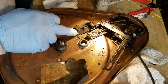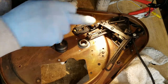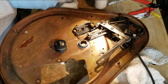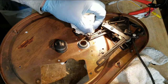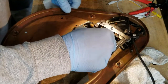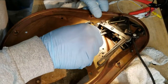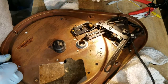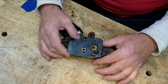There are pivot points here, here, and here — I lubricate those with a little oil. Put one drop on a screwdriver, touch the pivot point, and the oil will through capillary action go right into that spot. Then move it and dry off the excess — you don't need a lot of oil there, you just need to create a film. Get rid of the excess because it'll collect dust. I'm going to go ahead and get the rest of these clean and wipe the excess off all these lube points.